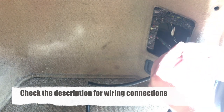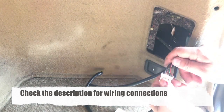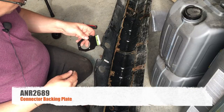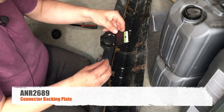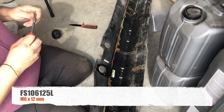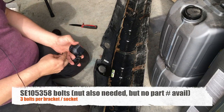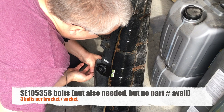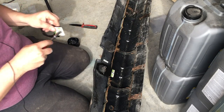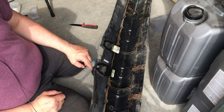Fish out that connector. It comes with ready pin-out but I'll just cut this off and splice in my own connectors and solder everything. On the back of the fender we'll install these reinforcement brackets using a bolt — it's an 8 millimeter hex head. You have the trailer socket and a bolt through it into there, with a washer and a nut on the back side. Run your cables through here and connect them to their plug.